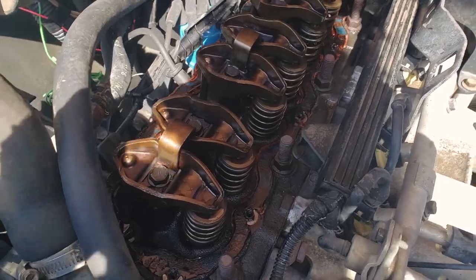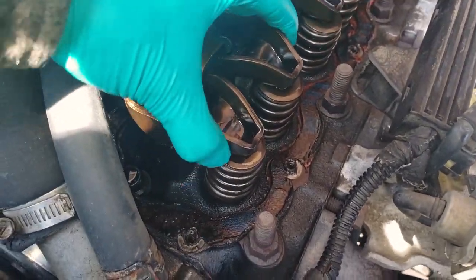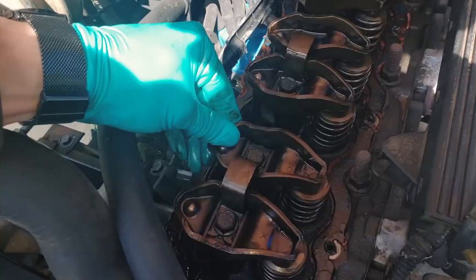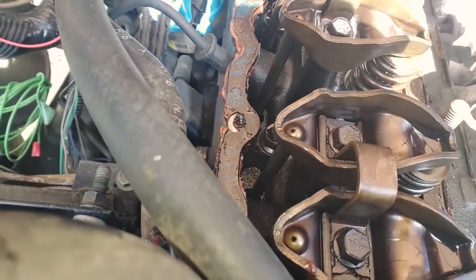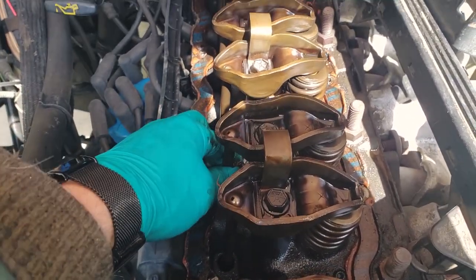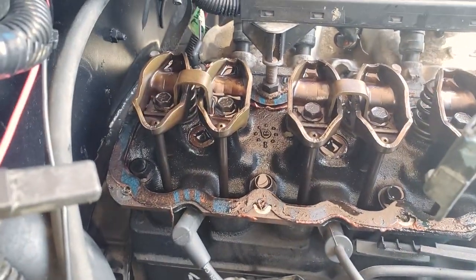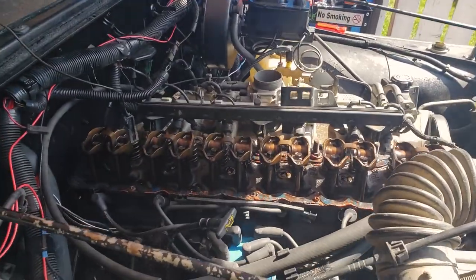Let me turn on the flashlight and check these. Some of these will be under tension. This one feels a bit loose, to be honest. I don't see anything indicative of anything else here other than some gassy material on this lifter or pushrod. Oil is supposed to come shooting out of here, so I'm going to set up the camera, connect the negative battery terminal, and see if anything emerges.